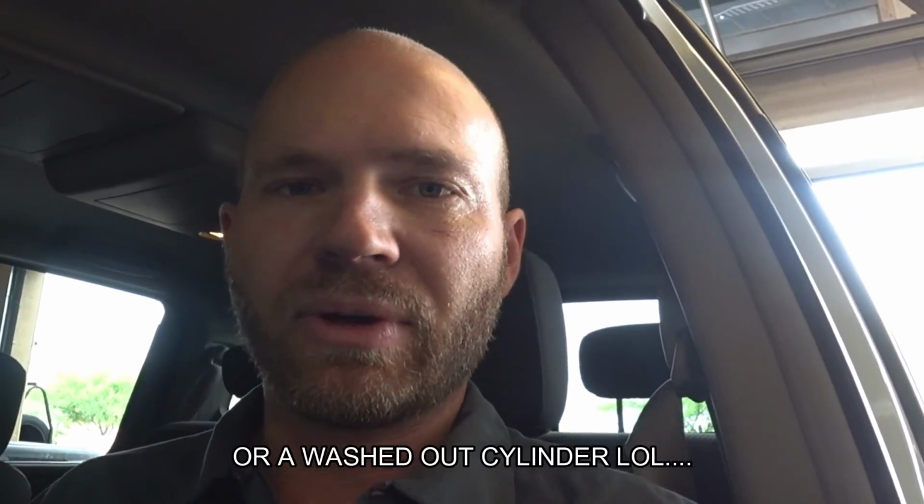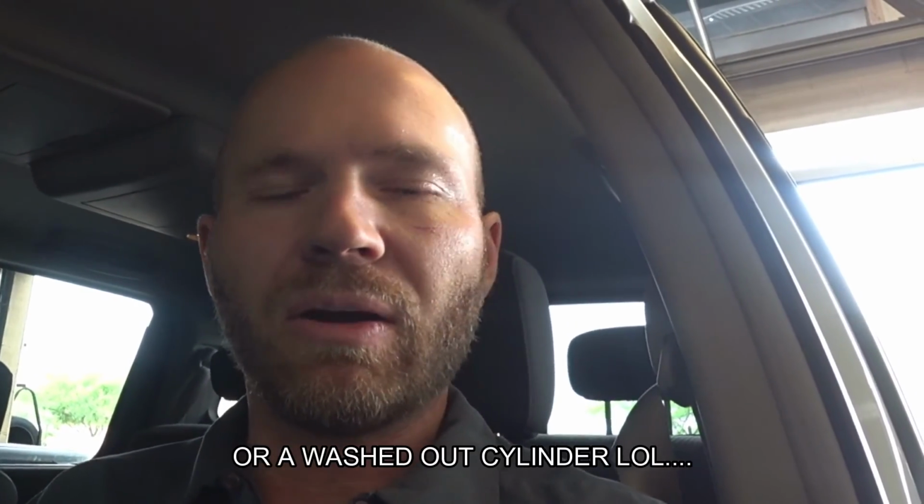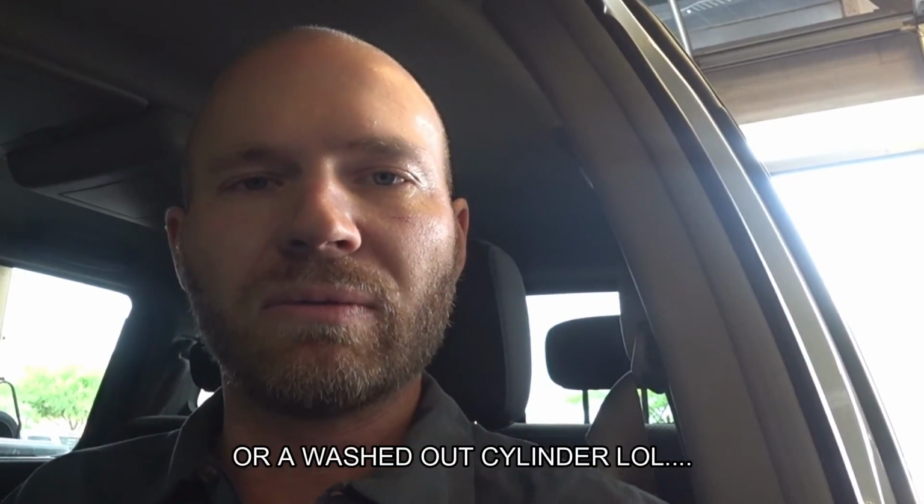So just remember, if you are not sure, continue testing. Do not condemn anything just off a failed RC test. That's the starting point, and you keep going until you pinpoint exactly what's going on with the issue. Leaking valve, leaking piston rings, the list goes on. So always verify.